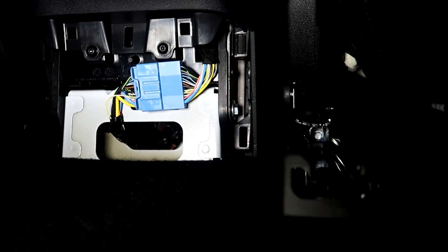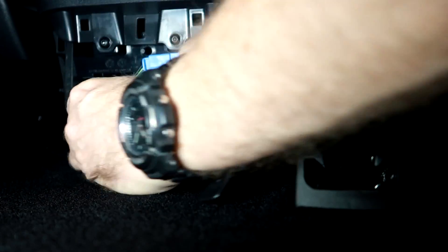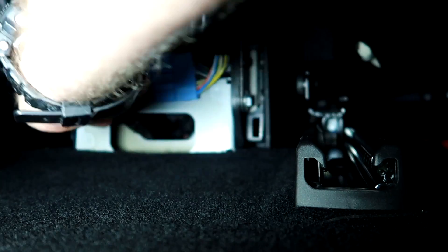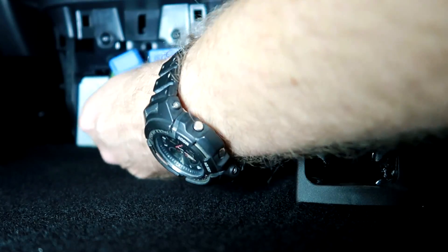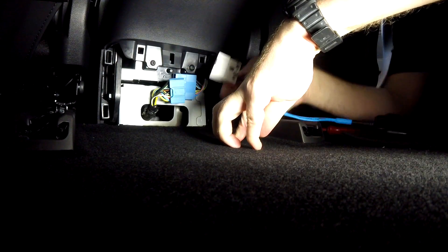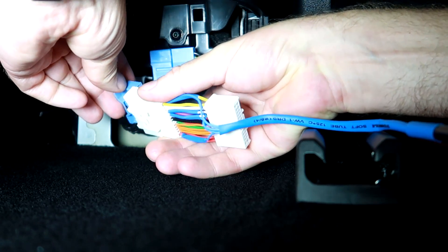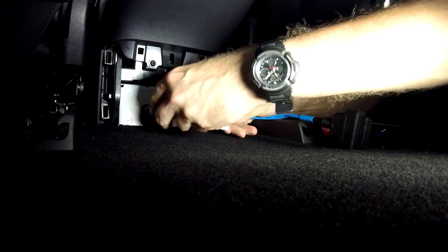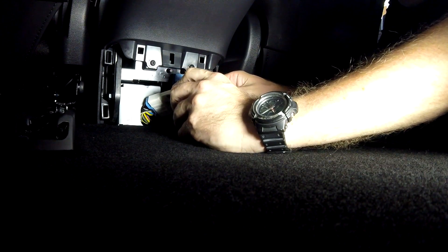About 11 minutes after shutdown, I think I heard a click sound. The car is not responding to anything anymore so I think it's totally shut down and it will be safe to disconnect. There's a security clip on this side which you press down and then disconnect the female part, which is a little bit hard. Screwdriver helps. And now we just tuck the new adapter in between and plug it in — clack.